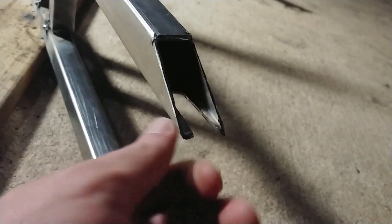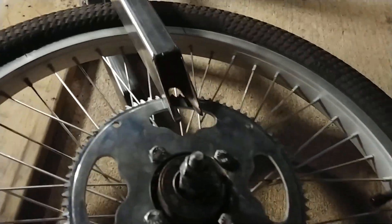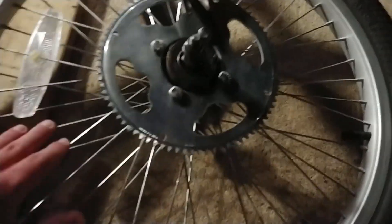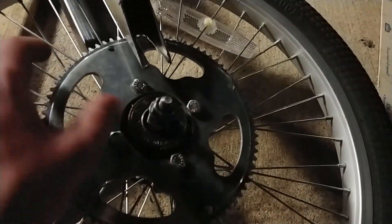Unfortunately, I got so caught up in aligning that I didn't think about whether I was welding the handlebars to the top or the bottom of the chassis. It does make a difference — it means this wheel has to go on facing upward, because this is the only way it fits, since the sprocket will hit one of the pegs. The motor is going to be turning the wheel the wrong way — it's basically on backwards. You can only drive it by turning it this way, and according to how I welded the front, it would be going backwards.